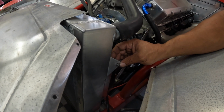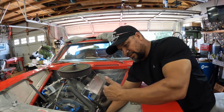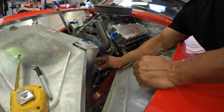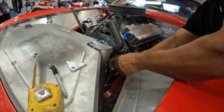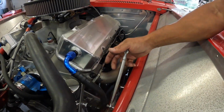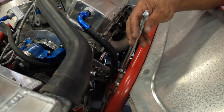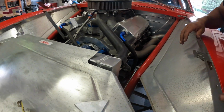It doesn't have a traditional frame, so you have to make everything. Normally you would just put it in there, put the top plate on, and you're done. But this is a race car, so it's a little more involved. We got to get creative with the mounting geometry. These are tube nuts on each side, with stainless steel rod with heim joints at them. We'll make some spacers and mount it all up. So that's that project there.